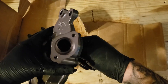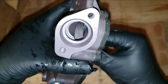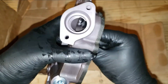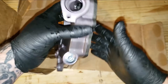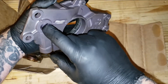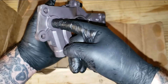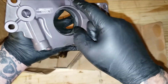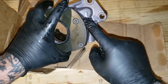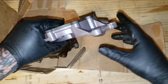You can see inside the gears and how it works — it just kind of rotates. The transmission pump is set up somewhat the same way. Oil goes in here, gets spun around, and comes through here. There's a little plunger down in there which a spring is putting pressure on. When the pressure builds up to a certain amount, the spring presses down and then you've got an oil bypass. That keeps you from blowing your oil filter and everything. You can't really tell unless you take the pump apart, but it travels back into the system.